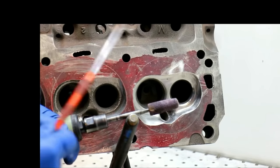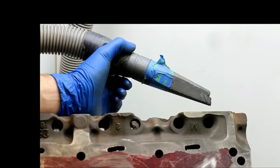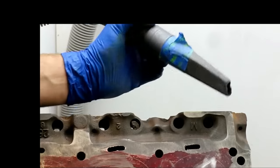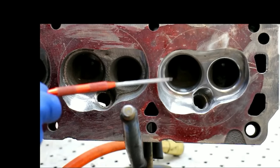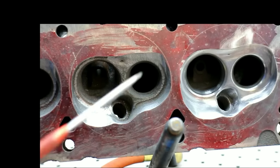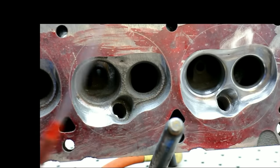What we have here is a half-inch diameter 80 grit sand roll. We use this to finish up the chamber — and you can see I took out the seat protector valve. If you have a steady hand, you can do it without. Why would I take my valves out? It's because I can put the vacuum cleaner in the port and it will collect all the grit. Be sure to radius around the spark plug hole and make sure the surface around the intake valve is either concave or flat. Note the valve seats are shiny — DV used one of his techniques to finish up the valve seat profiles because they were close and we didn't want to use a grinder.